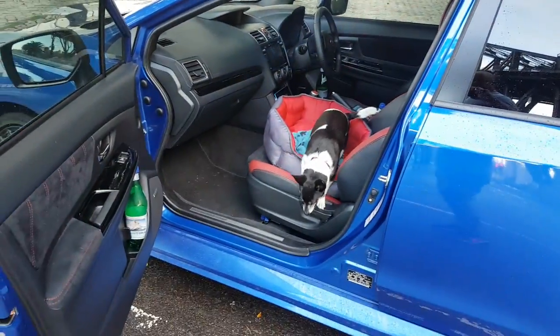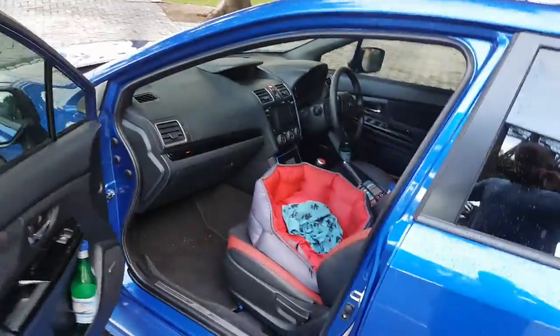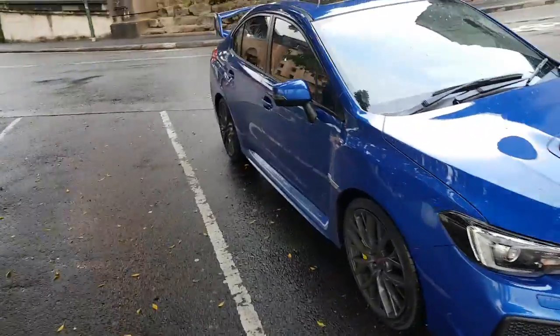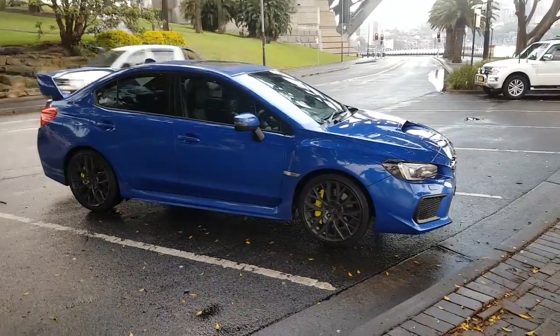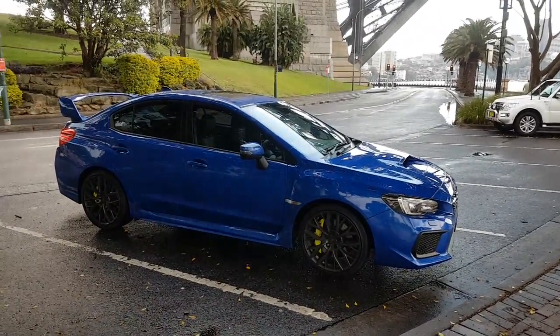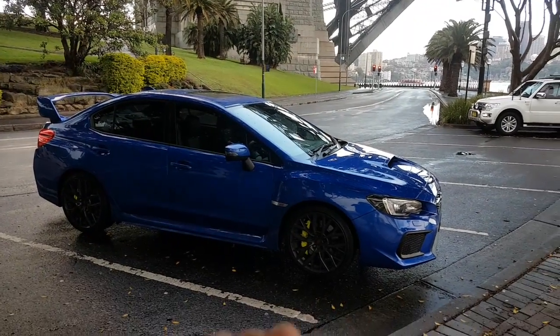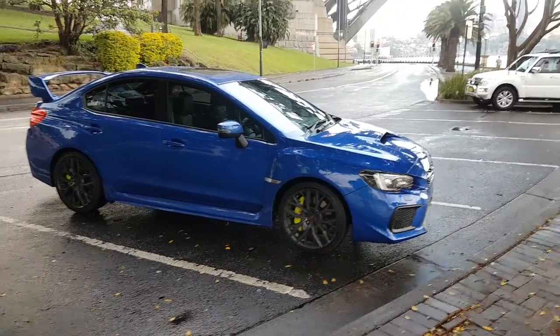So yeah, it's raining and it's properly actually wet. I left home and felt the front slipping around a little bit. Come, baby, this way. Bit too much. So I've dropped it down to 40, which immediately made the car more comfortable. Even though it was all right, it made it more comfortable and it's increased the traction on the front. What would happen was, if you're pulling out of a right-hand turn and accelerate, the front of the car was doing this, which is great fun.